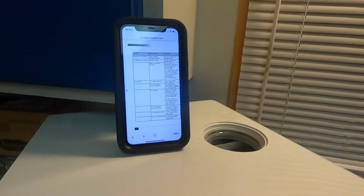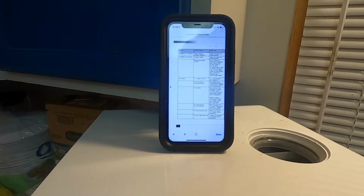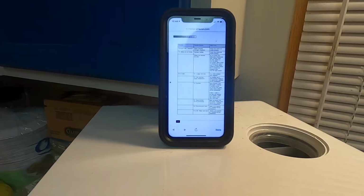All right, guys, so an E4 code on your Farberware countertop dishwasher is an overflow code. It's E4 overflow. Some element of the dishwasher is leaking. If overflow occurs, turn off the main water supply before calling a service professional. Now, the E4 code in this situation happened with an air refresh. The end of one cycle was being finished, and we kind of cut it off early.